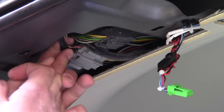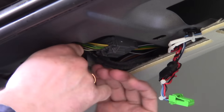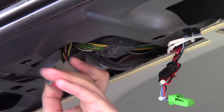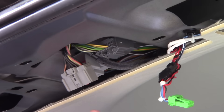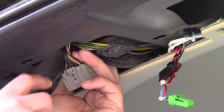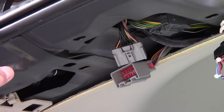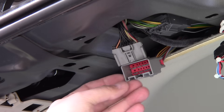Disconnect it by pushing on the tab — it sits pretty tight so you'll have to wiggle it. The other part sits on the roof liner; just use a screwdriver to push on the black tab to release it from the roof. What's interesting is that the tailgate is made of composite, so it's not metal and does not conduct electricity. Volvo uses a ground cable here for all the electronics on the tailgate, and the problem is that the ground cable on the actual connector gets burnt out because there is a lot of stress on it.